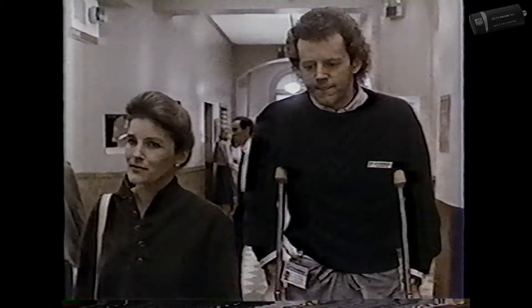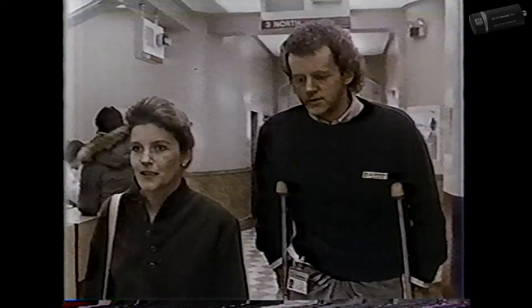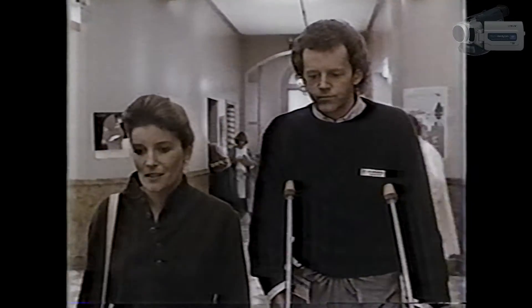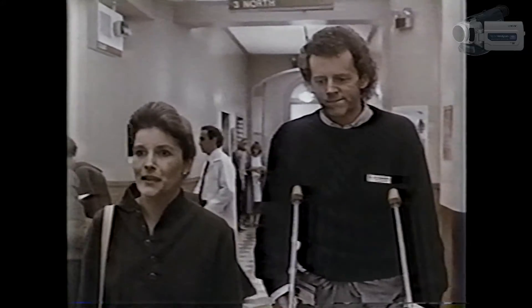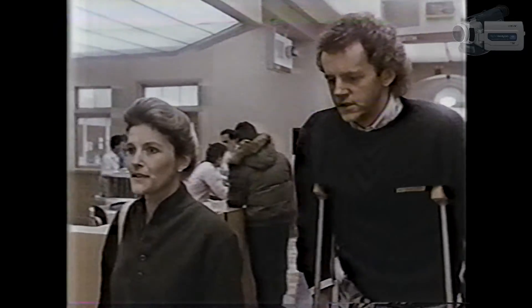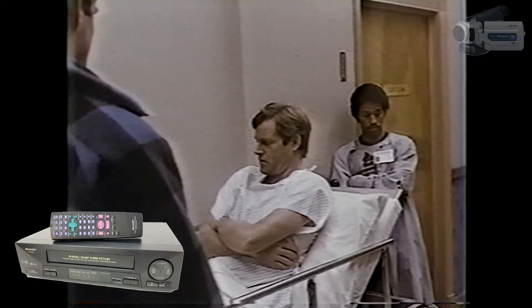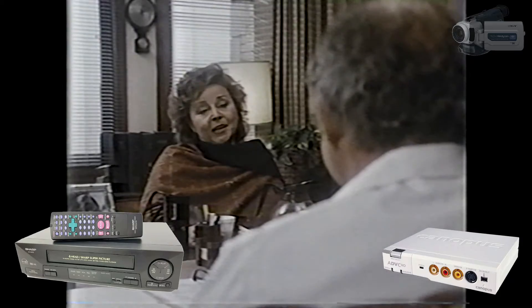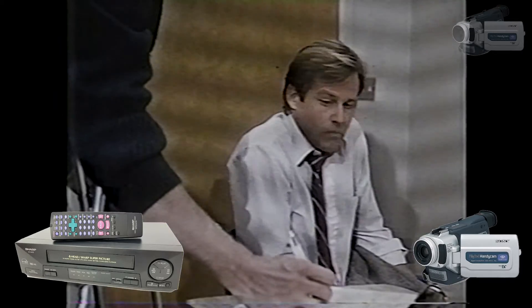This sample video probably isn't the best to compare an ATI capture device to the DV method — we'll do that test in another video with proper test footage. But even if the ATI turns out to produce a slightly better looking image, I think I would have to accept as legitimate the following workflow: a regular VHS player, such as the Sharp brand VCRs of the 1990s, flowing into a Mini DV camera, or the Canopus ADVC 110 that TechTV USA recommends. If this relatively inexpensive workflow can yield very similar visual results and fixes all tearing and flagging issues on bad VHS tapes, then why not use it?